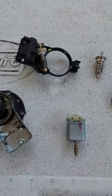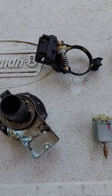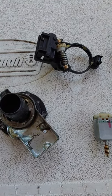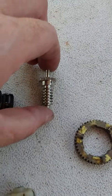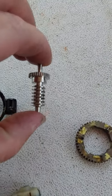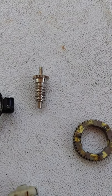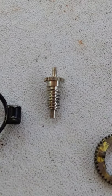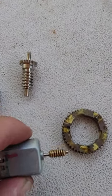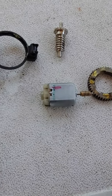After a lot of time messing with this whole mechanism for the GM 2007 to 2014 side-folding mirrors — I'm using these cheap eBay ones, they're okay — but the problem is when you replace this plastic gear right here with the metal gear, it'll cause the motor that drives it right here to ground out.